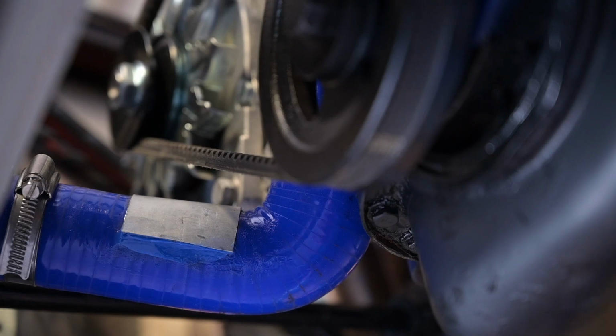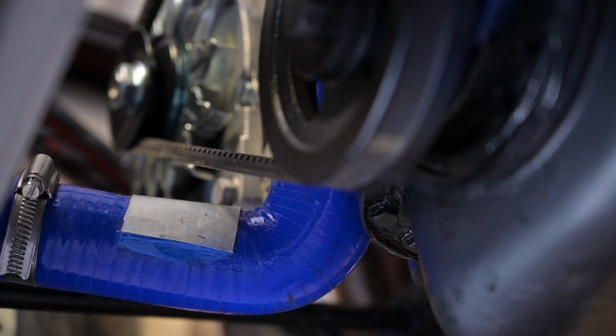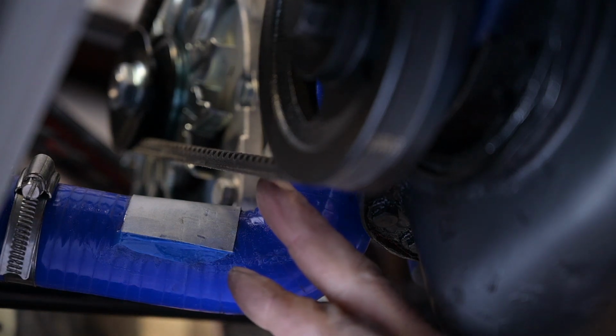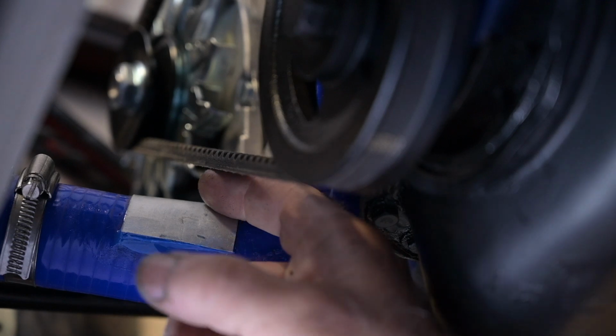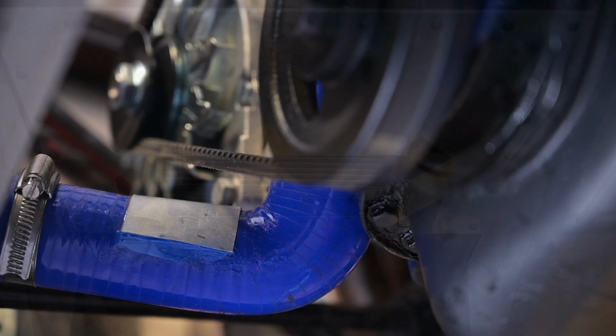So the way that I'm protecting the belt is with a small piece of aluminum that I bent over the tube and I glued it on there with silicone kit. And the belt is now a smaller belt, and now you can see I have at least an inch of play in between the two. So that should now be alright and not be an issue anymore.